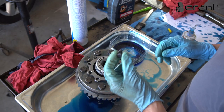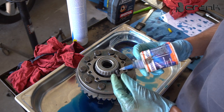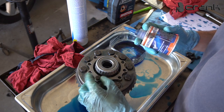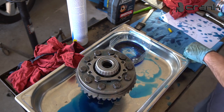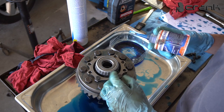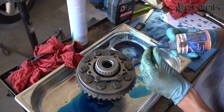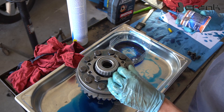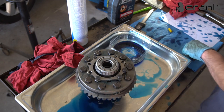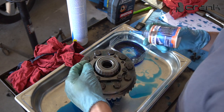Okay, so now I'm going to use the bolts to tighten up the cap on the top of the casing. So I'm going to put a little bit of thread locker on the bolts. I believe the original ones had thread locker too, so I guess it's a good idea to put on thread locker. Like that. Actually, you can tighten up this cap only with two bolts. So I guess if you tighten up all the bolts without thread locker, it's not going anywhere.